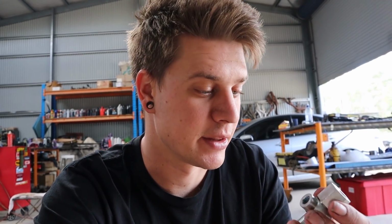And they also supply this, which is the oil pressure adapter. So the oil pressure sensor on these Gen 4s is at the back, in the valley plate behind the intake manifold. So it's a bit of a pain to get to, so I really wish that I did get this while I was putting the motor in, it would have been a lot easier. But so you take the factory one for the LS out, you stick this one in its place. The factory sensor for the LS then goes back into the top, and then we have our little 1/8 NPT off the banjo bolt head thing, which goes to the factory sensor, and then that should work on the dash.